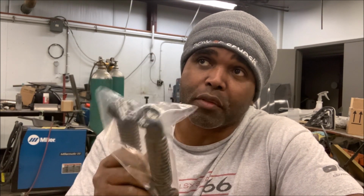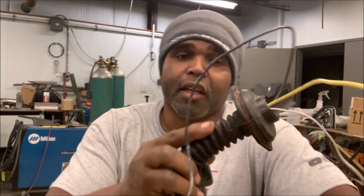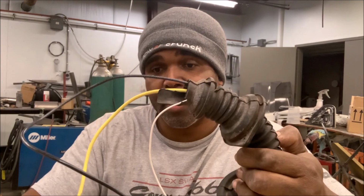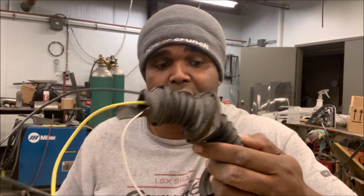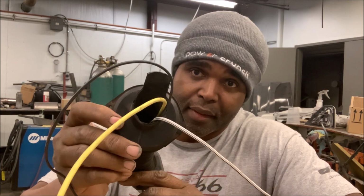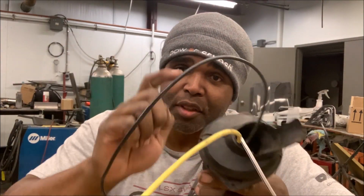But anyways, this is good if you're going from a non-electric window car to an electric window car, you need these. But if you have electric windows and you're just upgrading, you might want to keep the regular grommet that came out, because in the side of the cowl, the hole is bigger than this. With these, you're going to have to drill holes in your door and inside the cowl. But this one, it's already done. And the side of the door where the wires go through to the regulator, it's big, like this big. So remember, non-electric window cars, use the provided grommet; electric window cars, use the stock grommet.